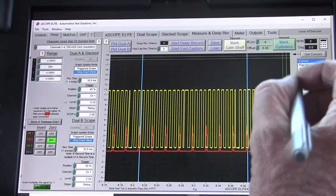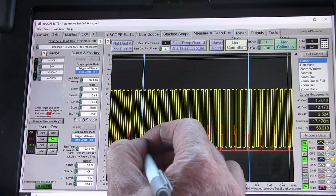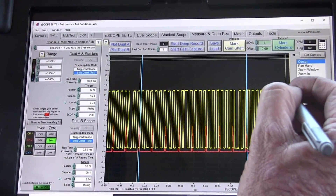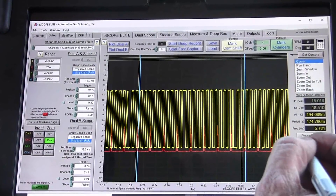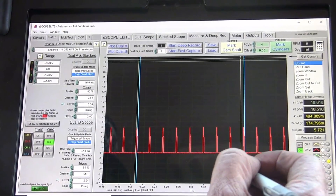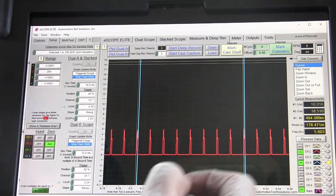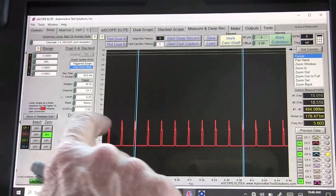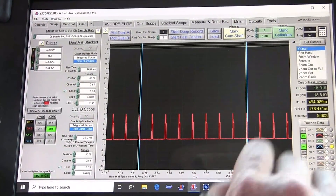So this is one fire cycle and this is trigger to trigger. I want to go get my triggers and bring those over and put those on my injector fire — I can see that injector fire down underneath there. That's the current. The red here is the amp clamp. So this is the current going to fire each injector and we can see all the injectors are firing and they're all pulling about the same current.